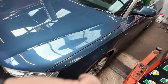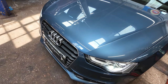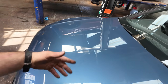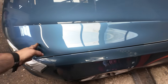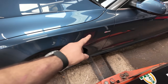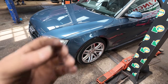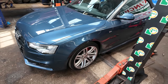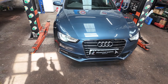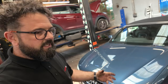It's another plot twist. I've had to put this car back together because we're getting on with the day. I spoke to the customer — like I said, we're getting 10 volts on one side and battery voltage on the other. The wiring loom runs along the wheel arch, and with the wheel off I pulled the arch lining down and visually checked for any corrosion, but everything seems to be okay.